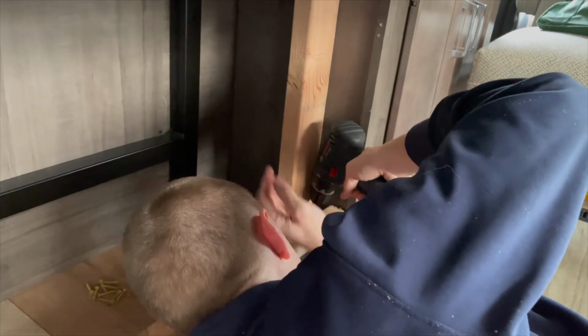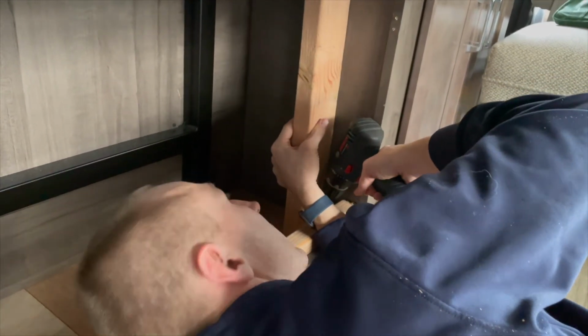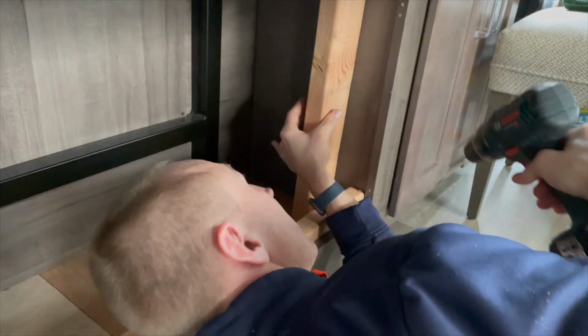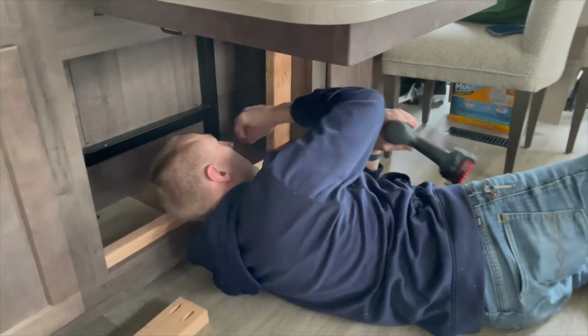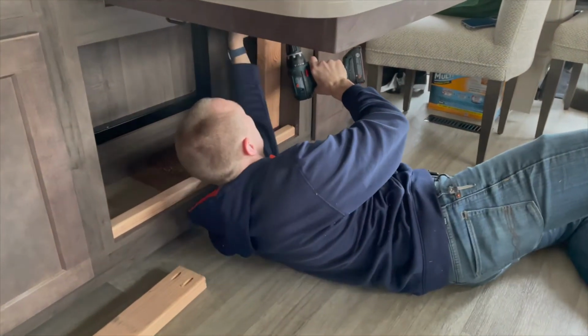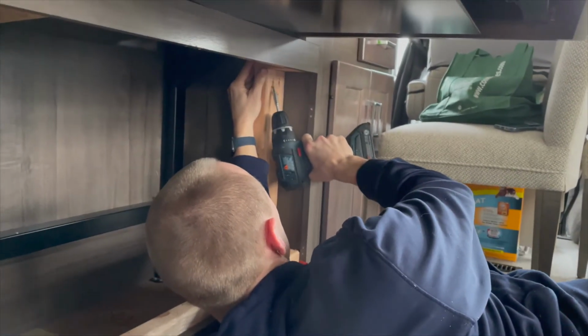So if you're plugged into your shore power, then that's just free power for you, and you're not using your propane. And if you're boondocking, you can still use the generator and run the fireplace, and you're not solely relying on just gas, because it's easier for me to make electricity than it is for propane.